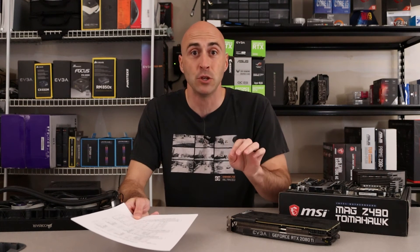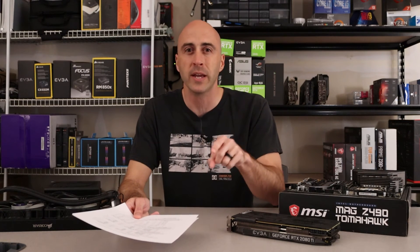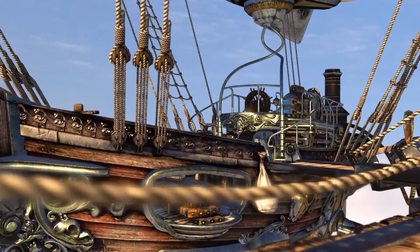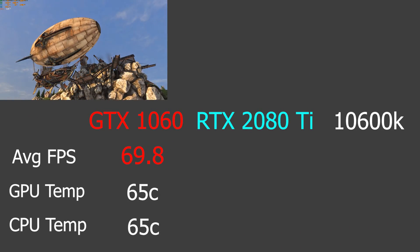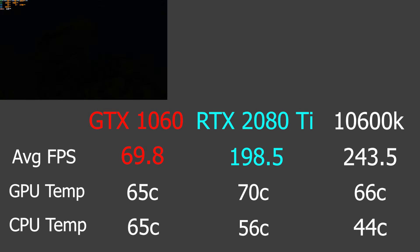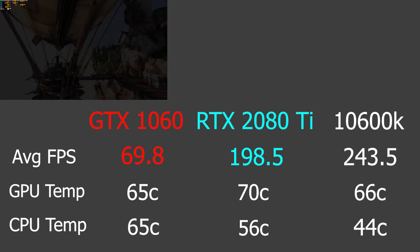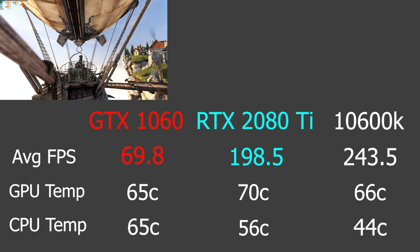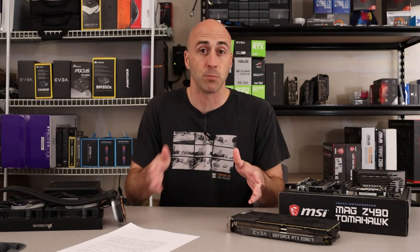We are no longer CPU-bound once I use a newer generation CPU. When you get rid of that 4-core 8-thread and upgrade to at least 6 and 12, or maybe 8 and 16, you get a much better playable experience. The last benchmark was Unigine Heaven on highest settings at 1080p: 69.8 FPS with the GTX 1060, 198.5 FPS with the 2080 Ti and i7, and 243.5 FPS with the 2080 Ti and the 10600K. Temperatures were great, and even though this benchmark wasn't really CPU-bound, it saw an FPS increase with both upgrades.